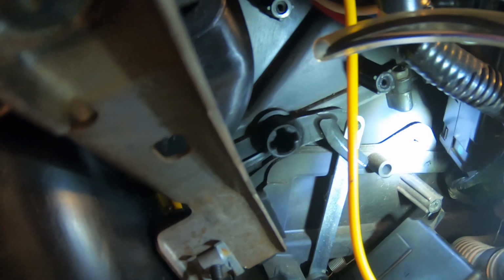And then we can pull this blend door actuator itself out. It takes a little bit of working it back and forth, because it sits the rod into it a good ways, but just gently keep working it, jiggling it back and forth, and again, round and round we go, but it is free of it. Just get that pulled out, and okay, now we are ready for reassembly.